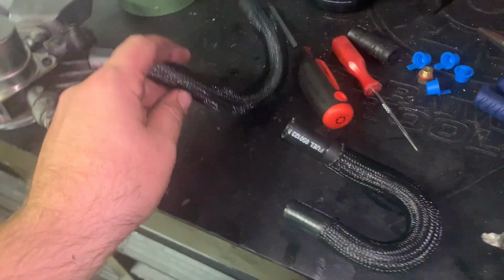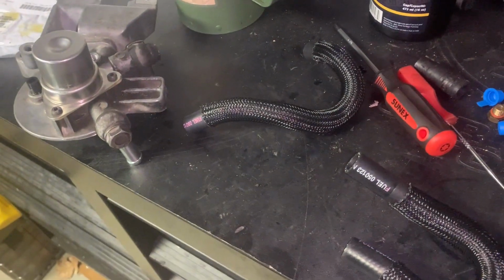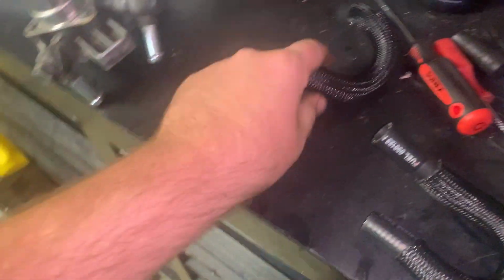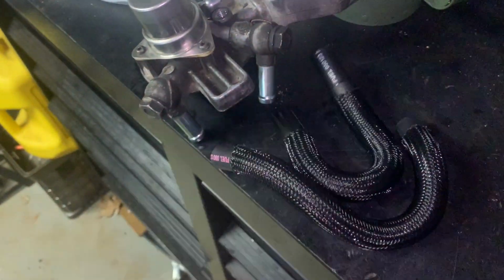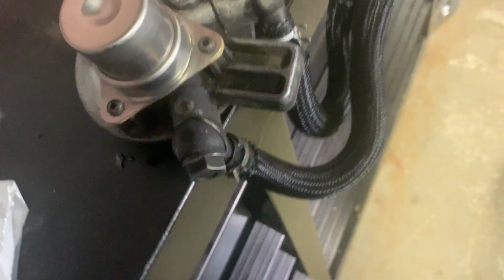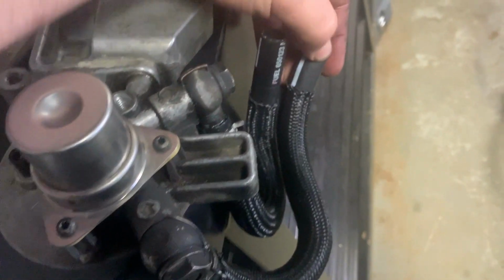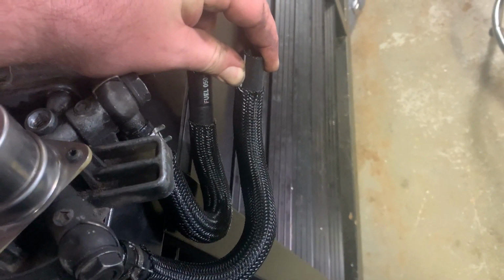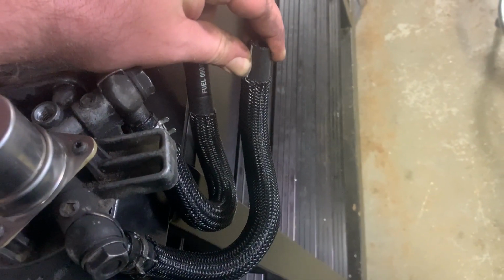Now that that's back together, we're going to want to get the 2 hoses on this side. You definitely don't want to mount this and then try to get your hoses on. You need to have one side or the other installed, just due to space requirements. So remember, the big one goes in the front and the little U goes on the side. All right, so once you put this back in the truck, the sides with the white stripes are truck side, and it's going to sit kind of like this in the truck. You push this down a little bit, and they'll be angled just a hair like this. They'll sit pretty much flush to the 2 hose pipes. The 2 other feed nipples are right about like that.